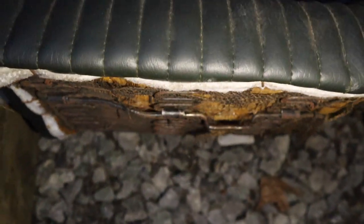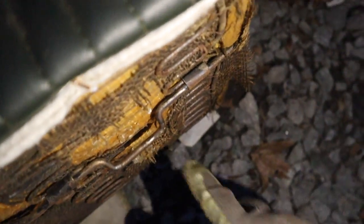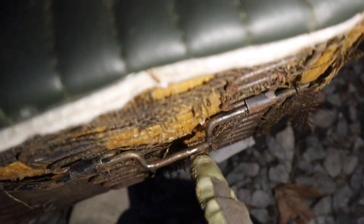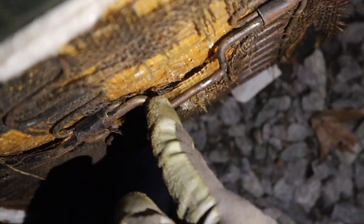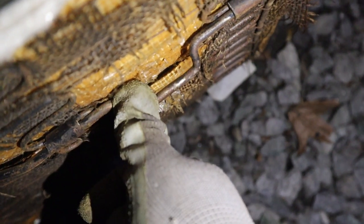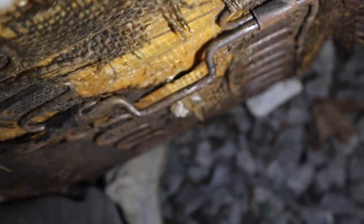And you're trying to take them off. There's a little hook. Let's see if I can try to hold this. There's this hook right here. That is what you're looking for when you're trying to take out these seats. You get a flathead or something, or a pry bar, and you try to aim for this. Push it back. Oops, can't do that one-handed. But yeah, push this back and up it goes. And then you can unhook it from the car.